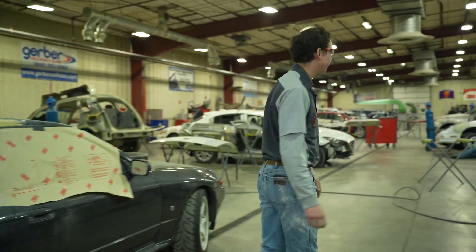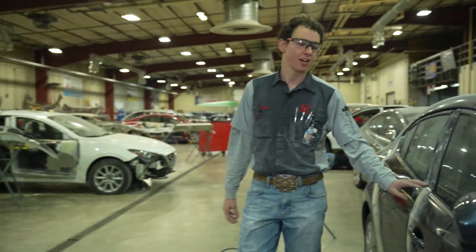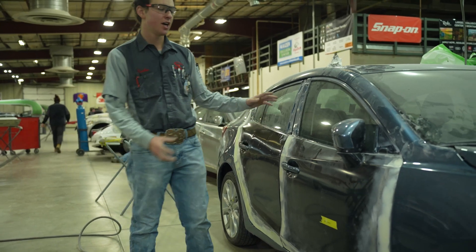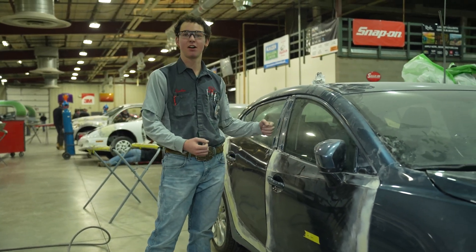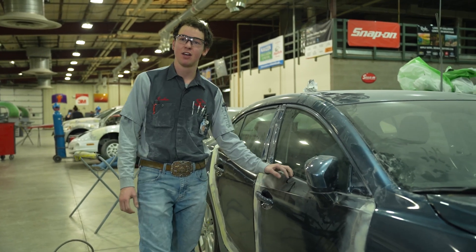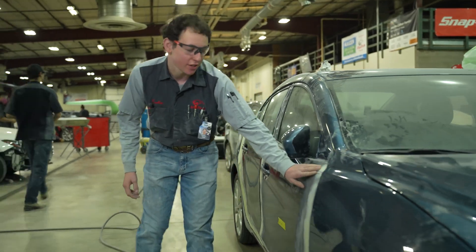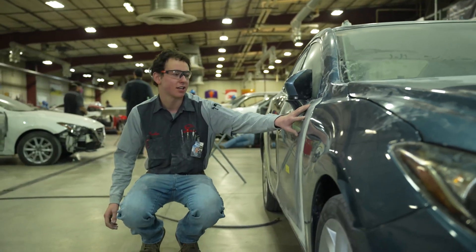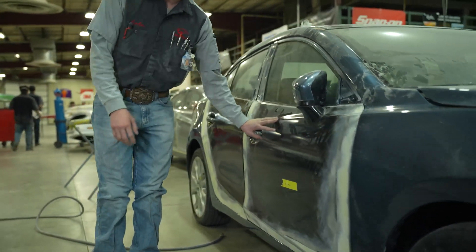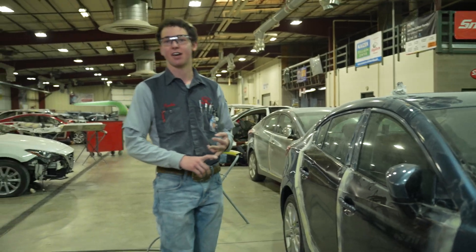As we move down the shop, you can tell some of these doors are not the same color. One of our comps is actually to take the existing door skin off and then we turn around and put a brand new door skin back on. A few of the things you learn with that is matching all the same body lines, so this aftermarket door skin is going to look the same as the original ones — all back to OEM standards, including all of your adhesives, your rivets, and even spot welds that you might have had to take out.